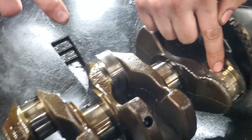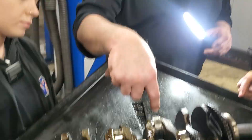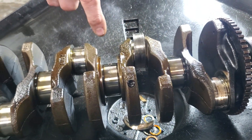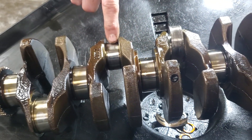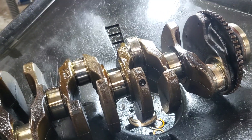It's like an autopsy. I just cracked off this side here. Can you tell from the outside that they spun? If you look at the two connecting rods that these came out of, they'll have the same pattern — more scoring on this because it spun before it seized. So these two will be clean, with a machined surface on this side as well as within the connecting rod, whereas these spun for a little bit before it locked up.